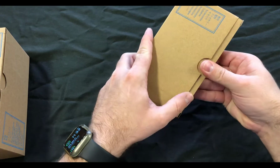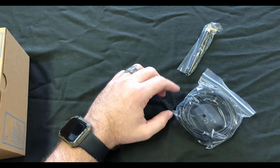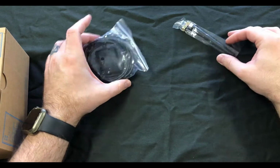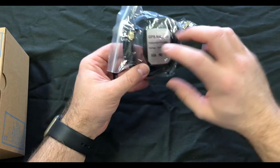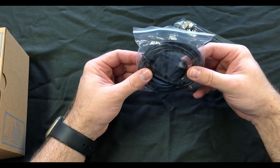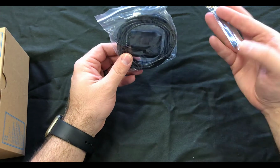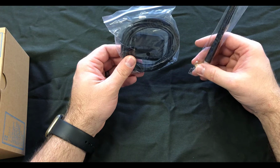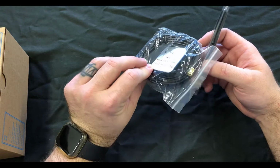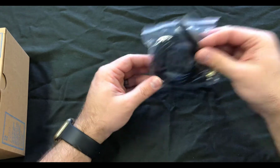All right, now we got your antennas. So you've got your cellular, and then you have your GPS. It is magnetic, so you can mount that on the top. Most of the time when I put these in, you can put it underneath the dash somewhere if you're really utilizing it. It'll triangulate with the cellular GPS as well, so it's not super critical, but if you have the means to route the wiring out to the outside of your vehicle to mount that, it's a good option.